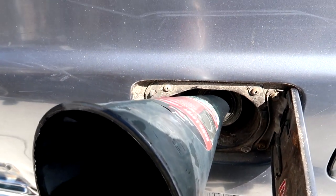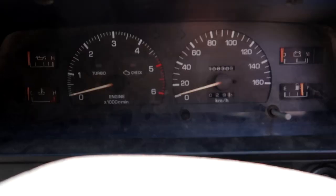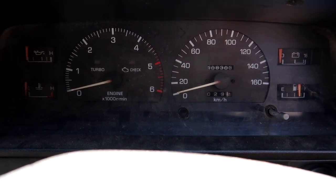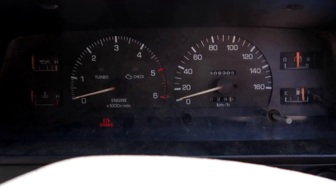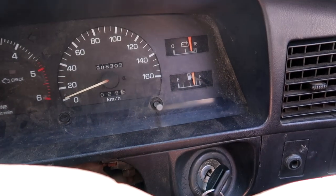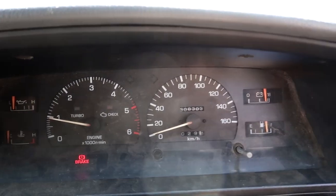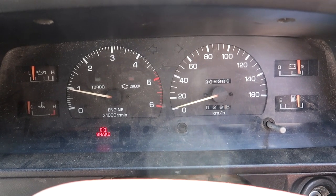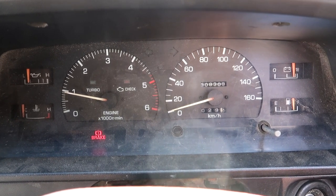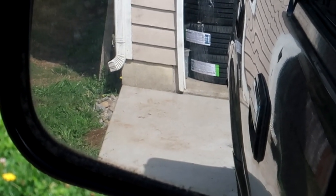All right, here's about another gallon of used oil going into the tank. So now it's almost a 50-50 blend of used engine oil and diesel. A pretty normal startup. So like 3/4 tank, about 50-50. Starts up no problem, no misfires, runs smooth. So just a little haze on free revving, but going down the road when the turbo kicks in, pretty much no haze to speak of.